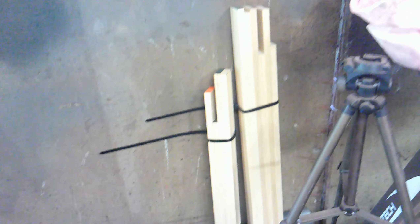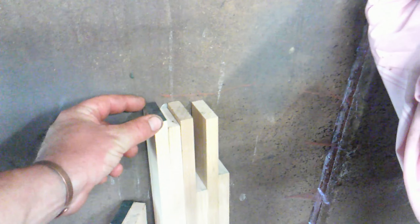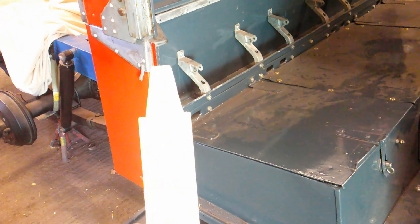While I'm waiting for the resin to go off, I'm going to make a start on the seat bases. A friend of ours has a joinery workshop and they've done these pieces of ash — I think they're ash. When we went to Land Rover Legends, I took some seats off of other Land Rover Series 1s and looked at how they were built. Basically they've got a frame around the outside with foam on the inside. This is for the seat base. They've supplied me with all these pieces — the correct width and thickness. Every seat has two of these pieces, one here and one there, and then two on top.